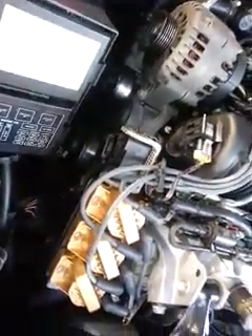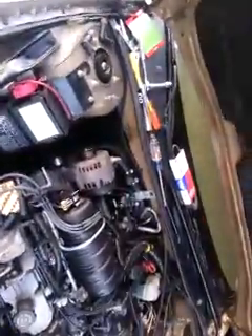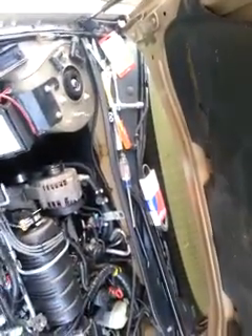Throwing the serpentine belt back on. I'm going to back-flush one more time to make sure there's no debris. I highly recommend using regular green coolant or an all-purpose coolant rather than Dex-Cool, because Dex-Cool eats up all these plastic components — anything it touches you'll end up replacing. Hopefully this video has been helpful. For $30 I was able to do what a shop would probably charge $480 to $500 for. You only need about six tools total — screwdrivers just to help line up holes, plus a wrench and a couple of sockets, and you're good to go.